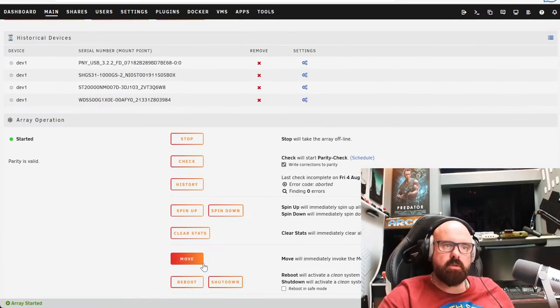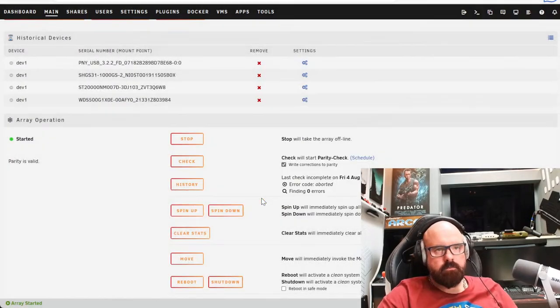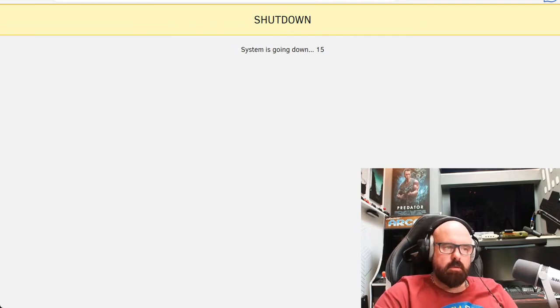So how about this? When I last ran it. Let me power the server off, throw the Sound Blaster card back in, and we'll do the VM with that connected as well, and a virtualized video, so that we could just see, is this going to work, is it not going to work, etc. We may have to uninstall the drivers that are there for the sound card and then reinstall, possibly.